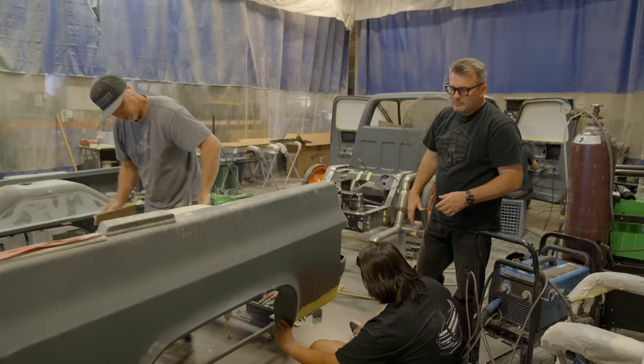You can see the rear quarter panels we designed. We put a ridiculous sound system in this thing — two four six eight speakers, two amps, two eight-inch Wet Sounds mids, nice mids and tweeters up front, and two 13-inch JL Audio low-profile subs. The amps are mounted under the seat. There's more sound system in this Bronco than any other Bronco out there. The customer also has an onboard air compressor, an extra front driveshaft, a jack, gas cans, and a 40-inch spare tire. We had to overbuild the mounting to make sure everything is on nice and tight.